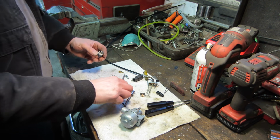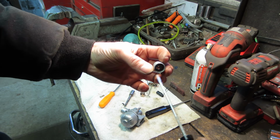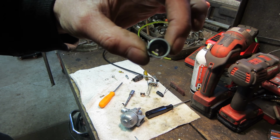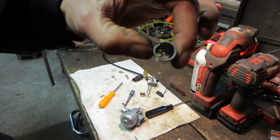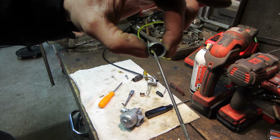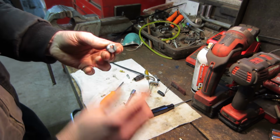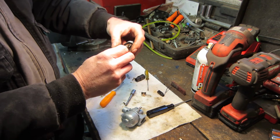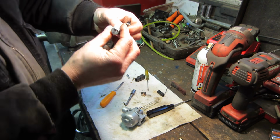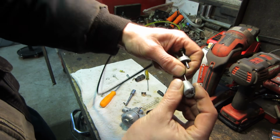And then what it has down in the carburetor, down in the center here, you see on the bottom there where it looks like two different size holes. I'm talking about the left hand side. That's where the cable goes through, where the fat part of the hole is, and then shifts up and pulls in and locks in. So it comes through. What if I just show it? I'm not going to be able to show it when I'm trying to assemble all that. But anyway, the cable goes in through that hole, over, and then locks with all the springs and stuff locked into it.